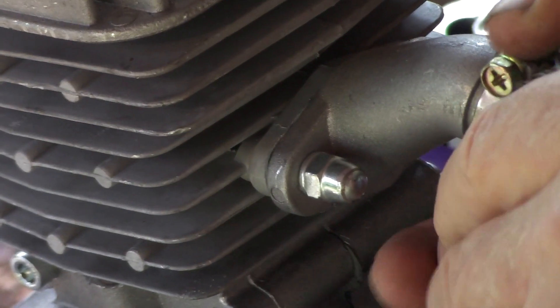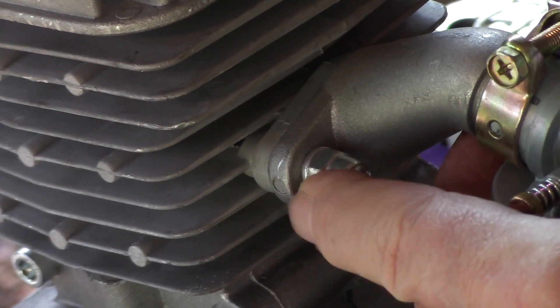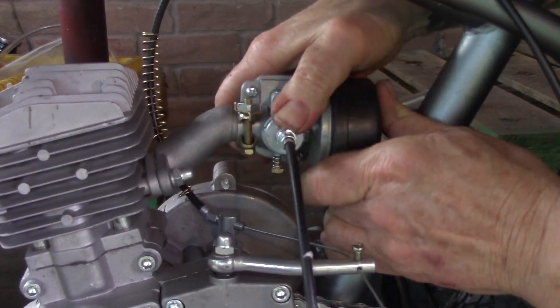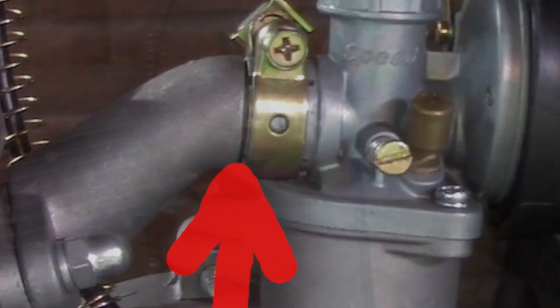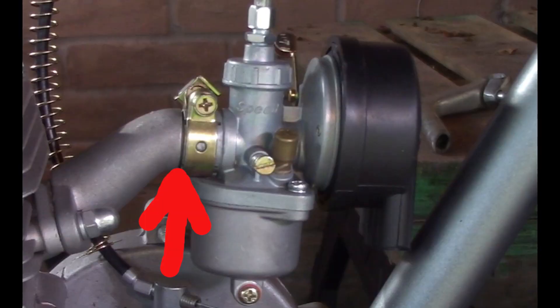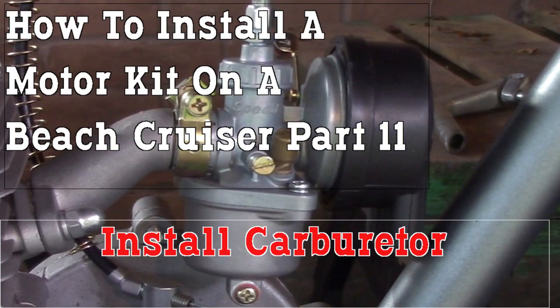After all that struggling, the intake was somewhat loose, meaning there's a chance for an air intake leak — if that isn't fixed, the engine won't run correctly. For an easier installation: you don't need a rubber O-ring, just push it in all the way. Take your time, push and twist, stay persistent. It needs to go in that far — keep going until you feel it bottom out. The bottom line is you must get the carburetor all the way on; otherwise you'll suck air through those four little grooves cut in the carburetor body.